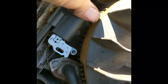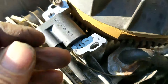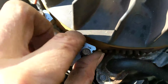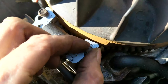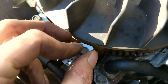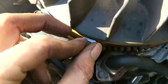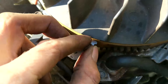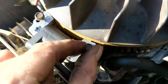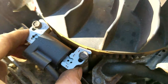We're going to set this up and get our first bolt started in the hole — that one's in. Now do our second one. Be careful when you're screwing these in: if you feel a little bit of resistance as soon as you start turning, you're probably cross-threading it. Take it out and make sure these are going in properly — get a decent amount of turns with your finger. If you cross-thread and snap one of these, you've got a whole new set of problems.